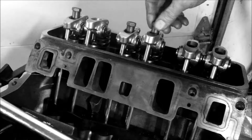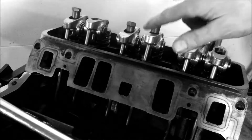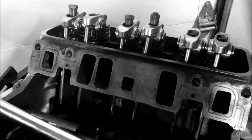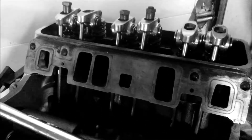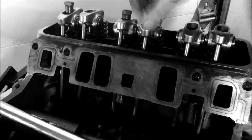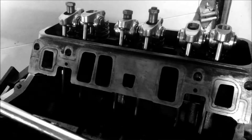So what our trick is, we're going to just put this down loosely. We're going to rotate the engine by hand and wait for it to go all the way down. Make sure it goes all the way down — you can't go down any further. The other one just went up.